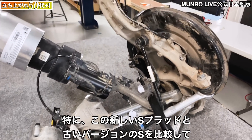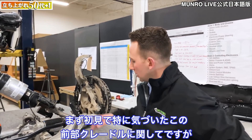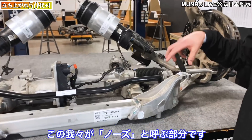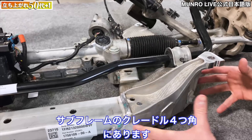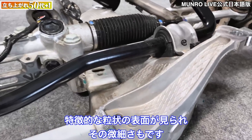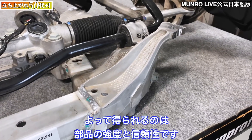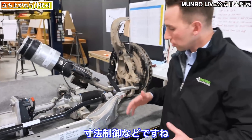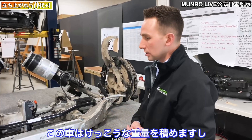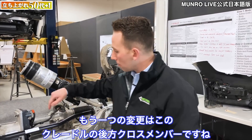Sure, yes Andy. We'll talk about it as we go through the rest of the vehicle as well. Some key differences that we saw right off the bat were on the cradle. In the last gen it was still an aluminum cradle, but all these nodes — the corners of the cradle or the subframe — were all sand cast. We can tell these are die cast by the types of features we're seeing, the level of granularity or fidelity in those castings. What you get from that is higher strength and higher dimensional control. For the Plaid it's better for high volume and better for strength — this car is designed to take on a fair amount of load given what it is and what it can do.